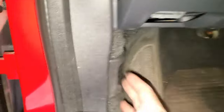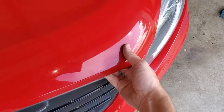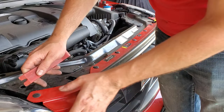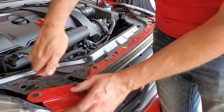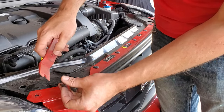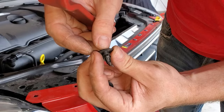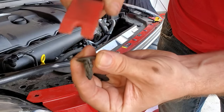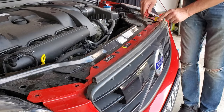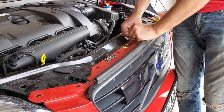Go ahead and open the door so you can release the hood. If you've never opened the hood on your XC60, the little latch is right there. We have a series of nine plastic push rivets — push pins, whatever you want to call them. All you need to do is push into the center of them and then lift up and they'll just pop out of place, or you can use the trim removal tool to pry it up. When they're locked they look a certain way, and when you push the center it actually releases the push pin. We'll go ahead and remove all nine.